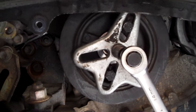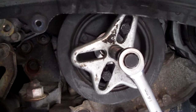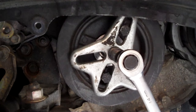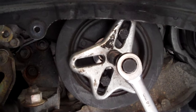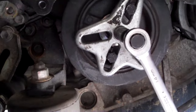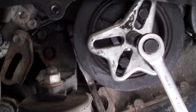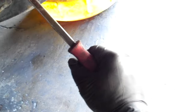With most of these harmonic balancers, or the drive pulley that drives the serpentine belt, it's necessary to use an impact gun to get it out, but then they just slide off. Sometimes they get a little stuck and you can take a pry bar and pry on one side with constant pressure, take another pry bar and just kind of wiggle, just pulse on it.